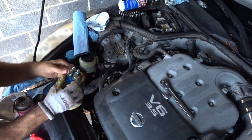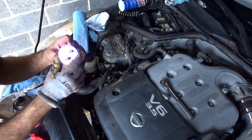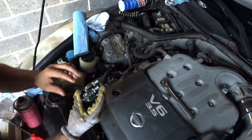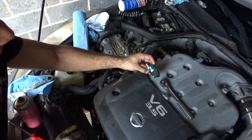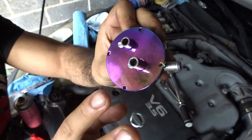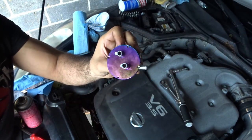Now this is proper — I have my PCV coming in through the long port and my intake on the short end. To avoid any air leaks, I'm going to silicone RTV all the way around on the intake and exhaust side. I'll torque these down — probably 60 inch-pounds. There are two little gaps — very little — but we don't want any air leaks in the system, so we're going to RTV those. We also need to put a little gap to fit the half-inch copper pipe since three-eighths wasn't available.